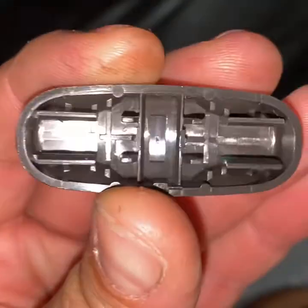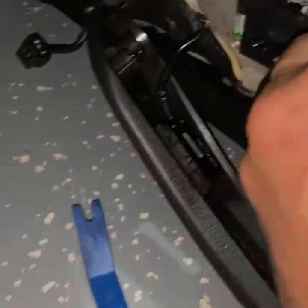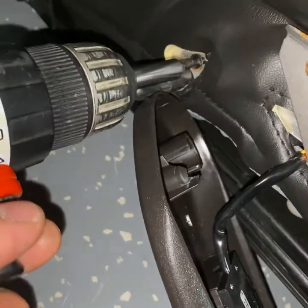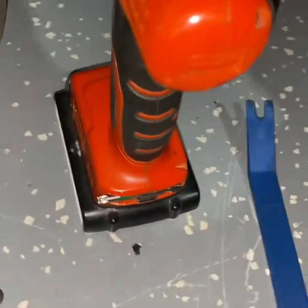Don't lose the screws - you're going to need them. Also don't lose this piece. This is the first piece to remove - it pops off - and then if you have a somewhat fresh side trim or side bezel you're going to remove a screw out of it. I'll gather all the pieces even the broken ones. The third screw is somewhere under the seat - there it is. So you have three screws plus the screw for the side trim, making four total.